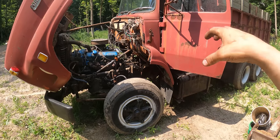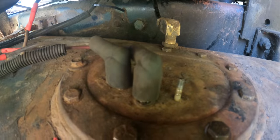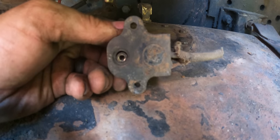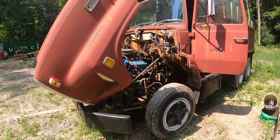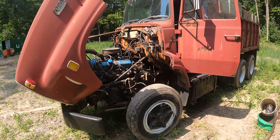I also changed out the plug on the old fuel pump and the way it was wired. This is what was in there before, but it had kind of a loose connection, so I just wired a butt connector straight. We'll build air in this thing, and the whole reason I wanted to start this was to move it up to the shop to change the oil and change the spark plugs, but spark plugs have been changed, so all we got to do is change the oil.